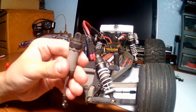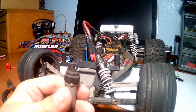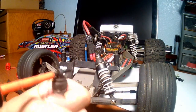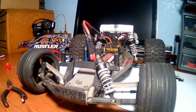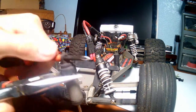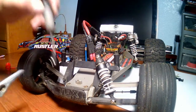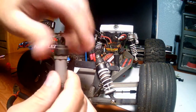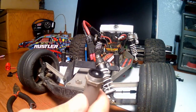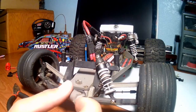Since you have the shock off, get the pliers and the Phillips screwdriver. This is how I do it: I put the Phillips screwdriver through here and use the pliers. There should be a hex thread on the bottom — just unscrew it like that. Once you unscrew it, you should see a little cap — that's the shock cap. Do not lose it.